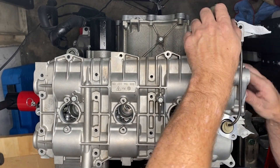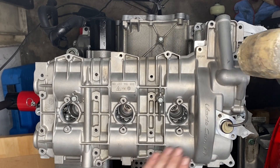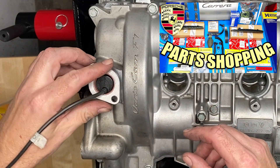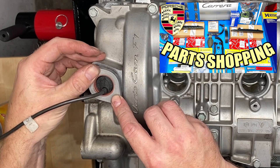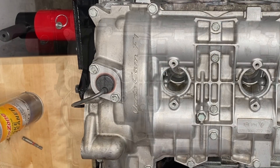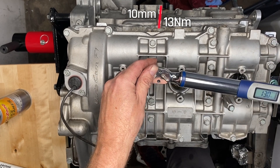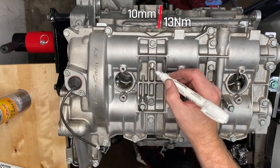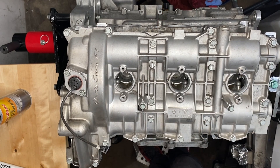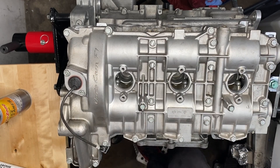We thread the VarioCam cable through the cylinder head cover and of course some rubber hammer action so we look super professional. The VarioCam cap came in the gasket kit from episode 24, with a couple of 10 mils on there. For the cylinder head cover there is also a torque sequence — that's number one of 23 — and in general it's doing a square out from the center, then a bigger square out from that.